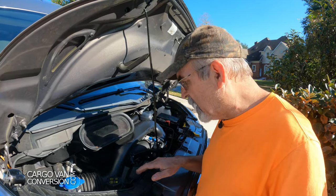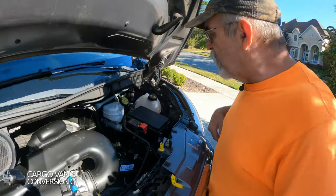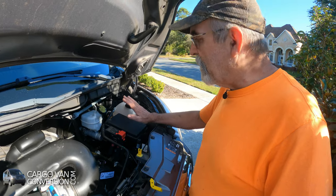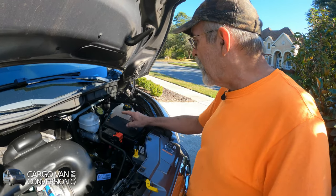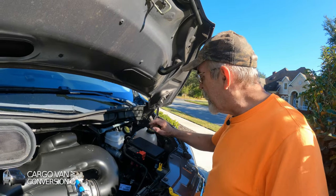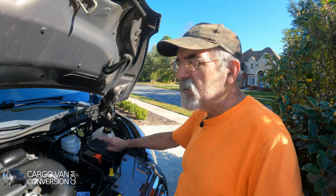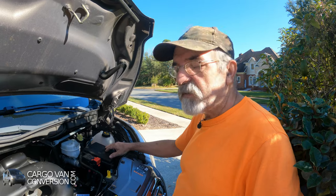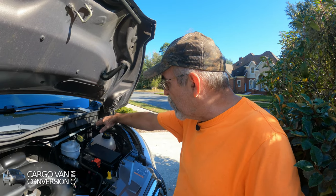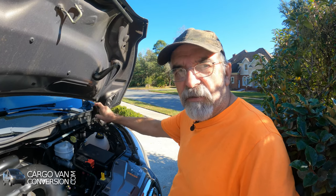There's no other wiring or harness that I can hitch a ride on, so that was one problem. Normally when the harness comes to the battery — in my case the battery is under the driver's seat — I could connect it here, a little bit awkward because one wire has to go over there and the other one over there. But Ford advises to connect it at the CCP, the customer connection point, also located at the driver's seat pedestal. Then normally the harness continues to the firewall, goes inside to the driver's area where you can put a switch to turn the compressor on and off.